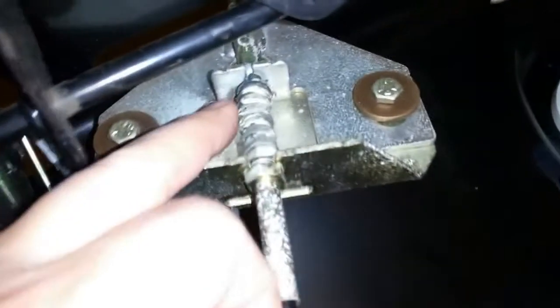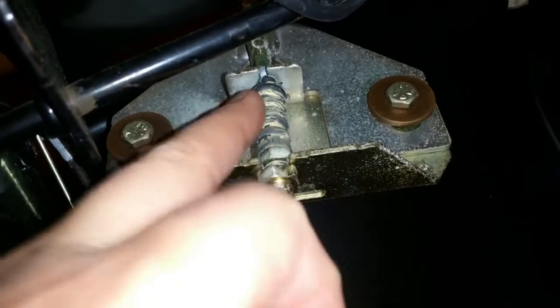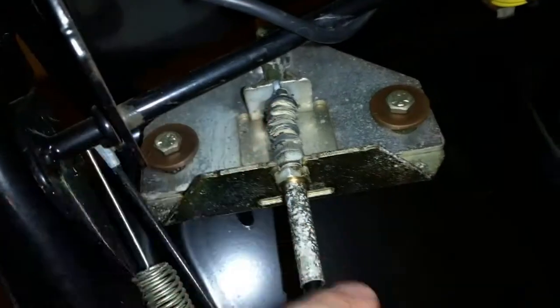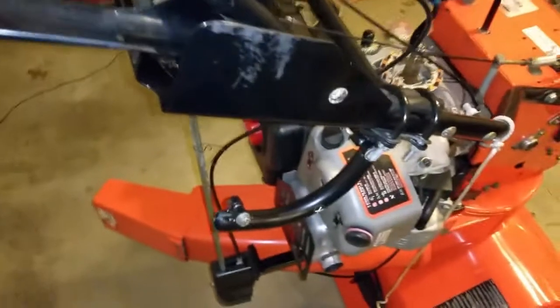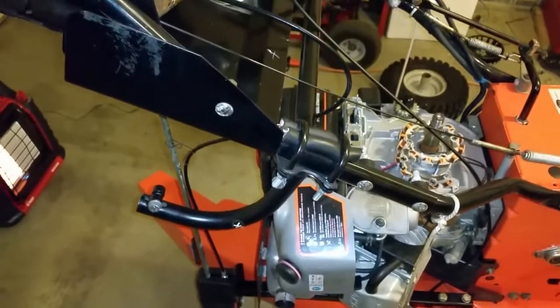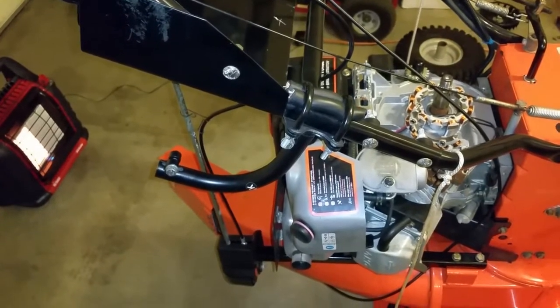The other thing I'm going to do is replace these rubber bellows. I put lithium grease on them to prevent freezing, but these rubber bellows burn out or rot over time. They keep water out of the cable lines — there are two up here and one on the bottom, which is the longest one. They're standard size, not exact replacements, and you can't get them from Ariens, but I'll find the closest match and link it in the description.